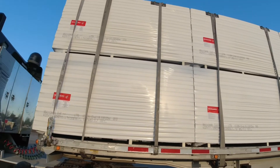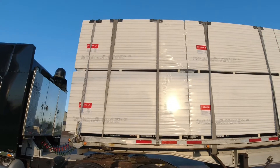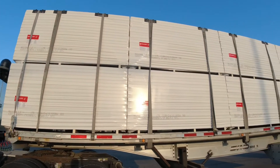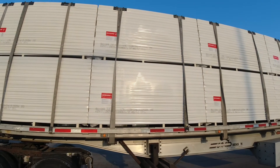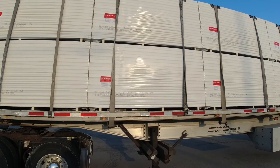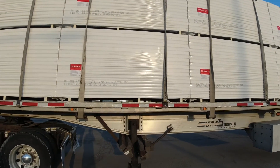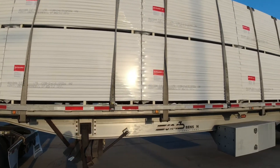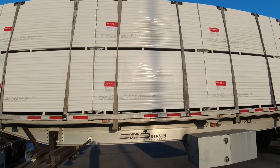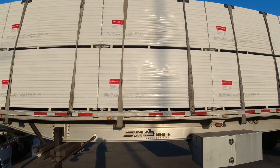I have another two-inch strap here because I'm driving a Benson and I don't have any four-inch strap ratchets. On the next stack I've got two four-inch straps pulling in the opposite direction — you can see I've got a spindle on a ratchet on this side and the buckle on the other side, so it's opposite on each side. This one here as well has two four-inch straps both pulling in different directions.